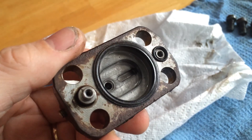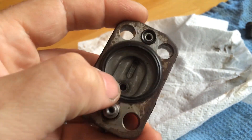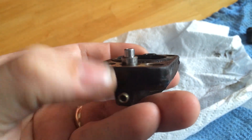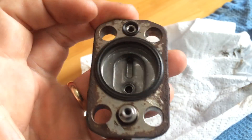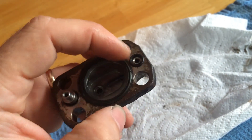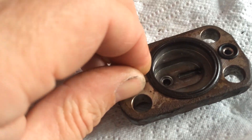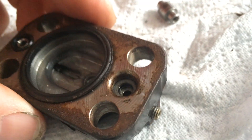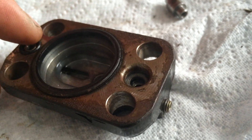This is the high pressure head that's off. The high pressure fluid goes up here and then comes out through this hole down here. To connect those two holes, it's been drilled across the top here, and the allen key ball bearing just blocks it off and stops it leaking out of the drilled hole. We're going to replace this seal, this one, and then there are some seals to get out in there as well.